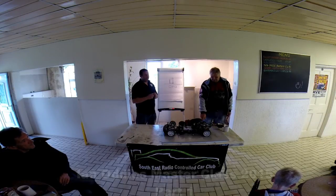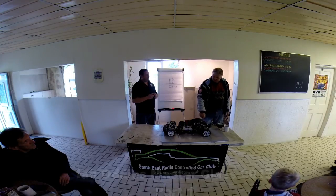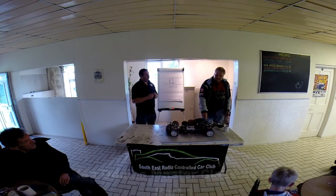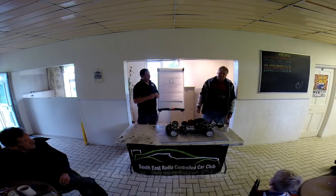As a rule, you should put a tyre gun against the tyres, which if you're taking things really seriously, you should be doing, and just check them as soon as you come into base, and check where the temperature is on the tyre as well, because it tells you the cambers. You'll find you can get these into 60, 70 degrees, absolutely no problem. You get to 90, bit marginal. Anything over that, you'll start sliding off straight away.